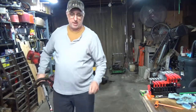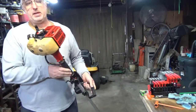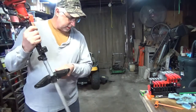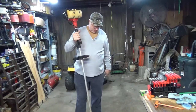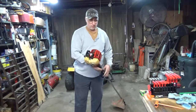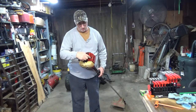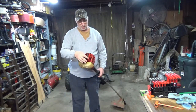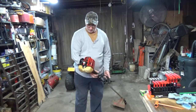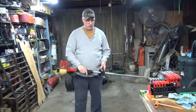That's an aftermarket replacement head for this Red Max BC2300 trimmer brush cutter — it's actually a BC2300DL, as in David Large. Like I said yesterday, this was picked out of a guy's trash. When I stopped and talked to him, he said you can have it, it won't run. When I got it home, literally the only thing I had to do was there was an arrestor screen on the back side of the outlet of the muffler where the exit port comes out. I just took that arrestor screen off because it was all gummed up and it's ran ever since. Then I also replaced the fuel line and the grommet where it comes through the tank because it was rotted out and leaking real bad.